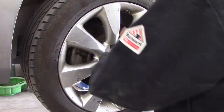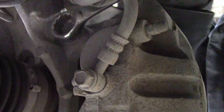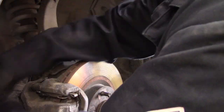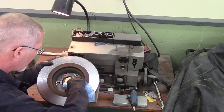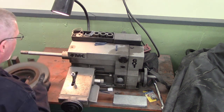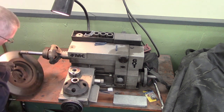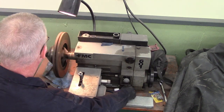Again, because I sure seem to go through front brakes. Basically, pull the wheel off. You've got these big honking bolts that I think are 22mm that are a little bit of a bugger to get at, but that unbolts the brake caliper bracket from the spindle. Then you want to hang that on a piece of — I usually use like 1/8 inch welding wire. Pull off the rotor. You can clean it off with an abrasive disc or a surfacing disc, or just wipe it clean. Set the rotor up — clean with no rust scale or anything on there.